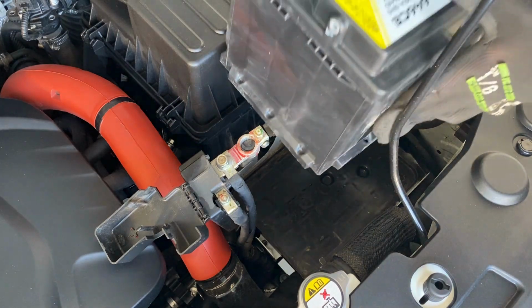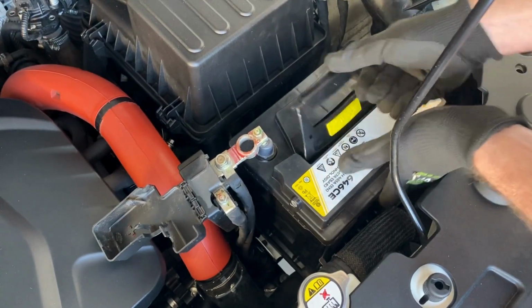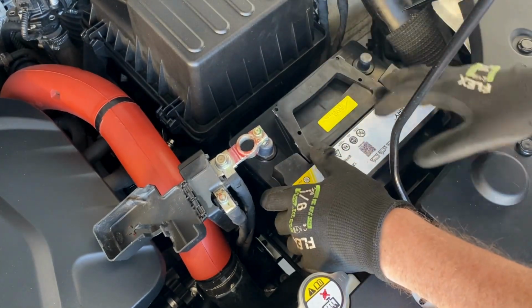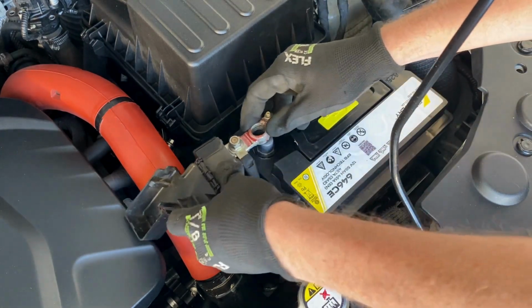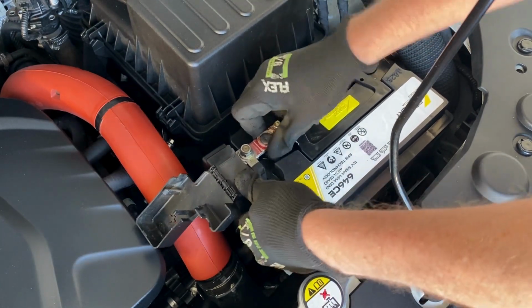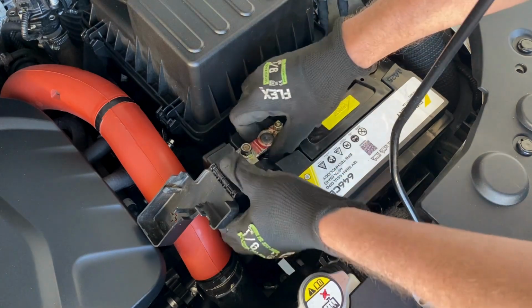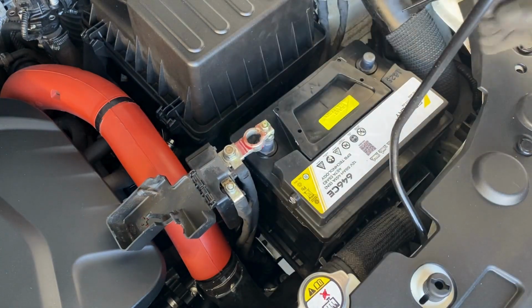Now the battery we used is almost identical in terms of electrical specifications, but I'll share the differences a bit later. This works as an alternative when the original isn't available. The drawback being that the posts are slightly lower, making fitment of the terminal slightly harder. For now, start the installation in the reverse order with the bracket first.